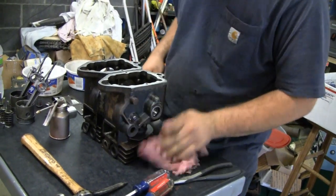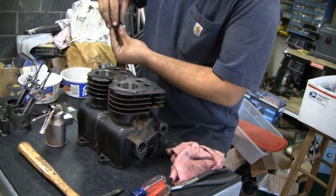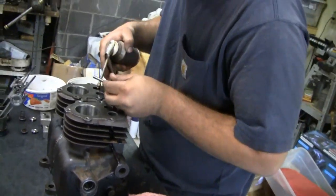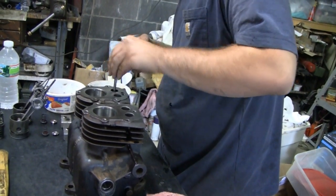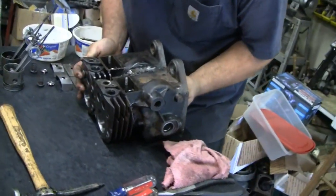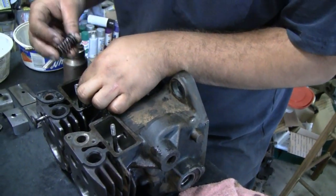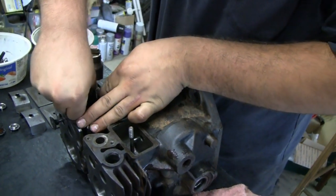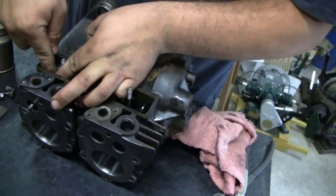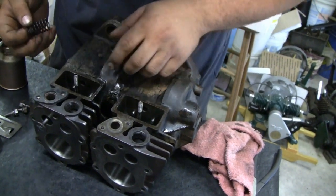Alright, now the valves. I might have to put this down - help you put them in there. Sometimes it takes two hands. I showed them the other day - re-seated them all and adjusted them and stuff. We'll do them one at a time. Put the spring in there. Oh, it's the intake - the intake valve takes the soft spring, the exhaust takes the heavy spring. I was just going the wrong way the first time. That was just a test.